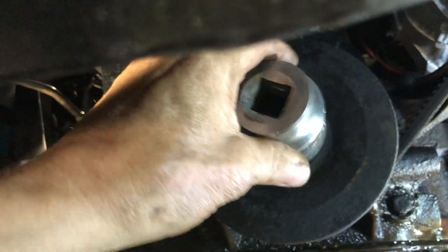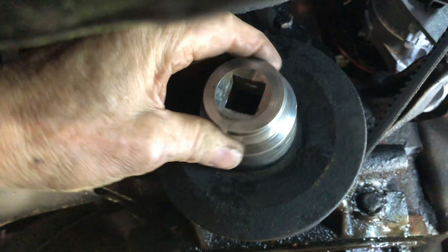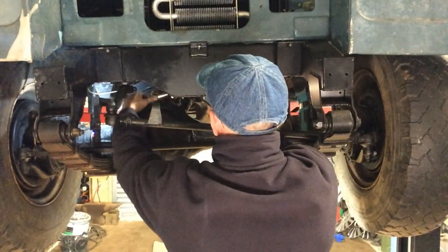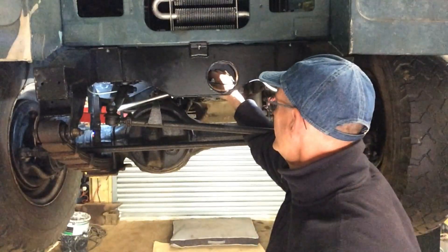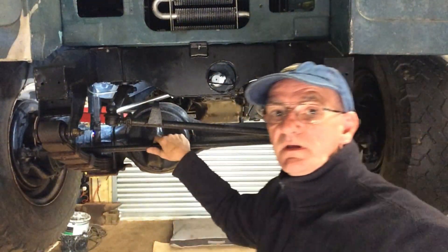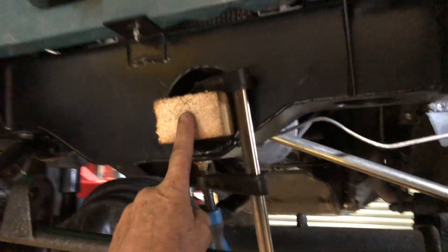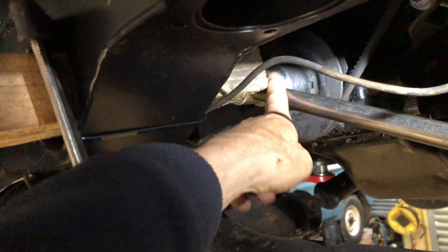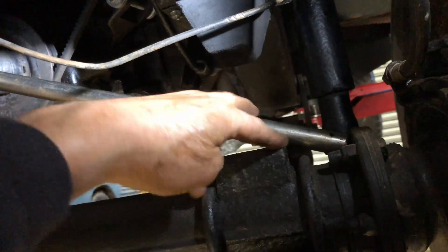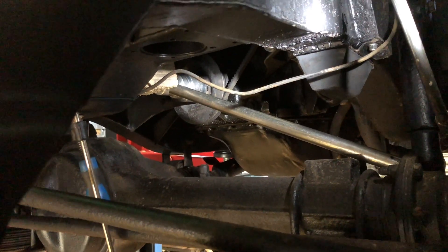Here we go, straight into it. This is a 41mm socket and it is loose on there — I haven't got anything else near that size, so this one's going to have to do. No matter what position I put it in, that bar is hitting the axle so I can't really get a purchase — I would be able to if I didn't have the radiator in. So here's what I've done: shoved a piece of 3x2 through there, clamped it up, and the other end is pushing onto the socket to keep it pressed against the nut. The bar of the wrench comes down and is sat on the axle. What I'm going to do now, which is the sketchy bit, is turn the engine over and see if it'll undo that nut.